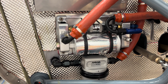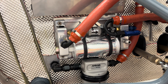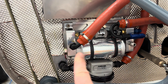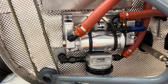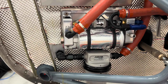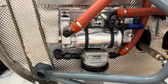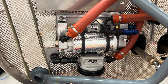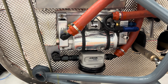In building my TSI fuel system, I made a couple of decisions to make significant changes from what Sling calls for in the manual. The big one is the incorporation of this fuel manifold assembly that I purchased from Midwest Sky Sports. This was designed by Henry, the owner of Midwest Sky Sports. He's a build assist center in Michigan and he's built lots and lots of Slings. He came up with this design to greatly reduce all of the fittings and the length of the hoses. So I purchased this from him and incorporated it into my fuel system.